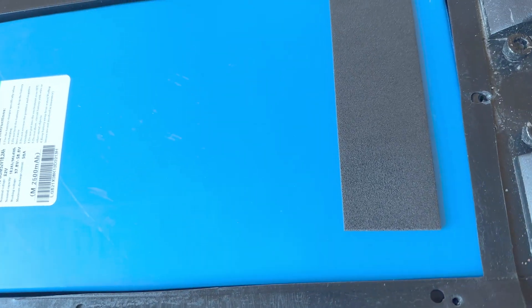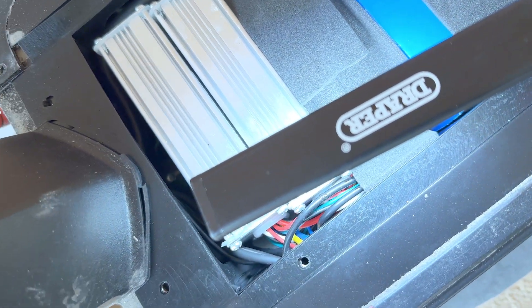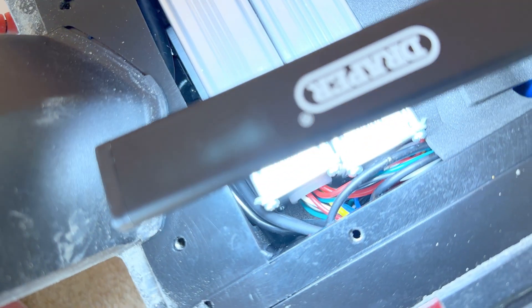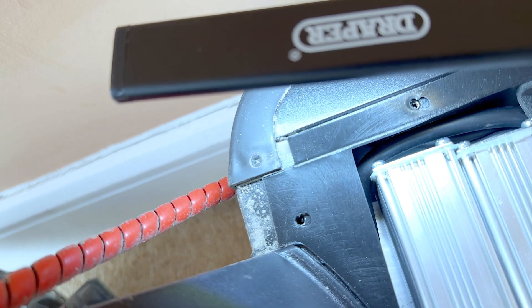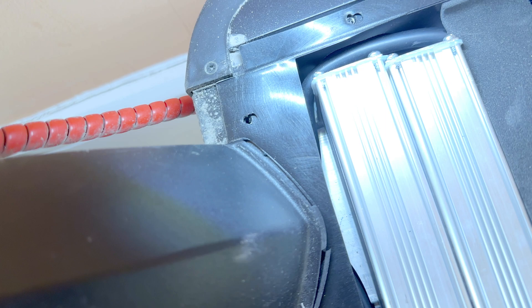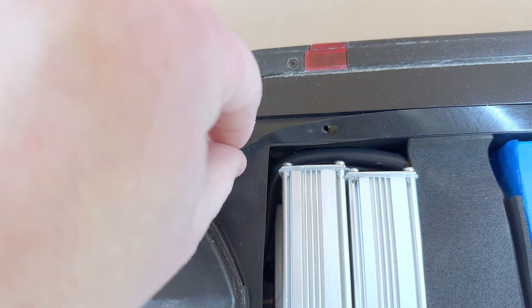Nothing is guaranteed, but when you do go to check, it's always a good idea to check where the gasket is, going around the electric scooter checking for water ingress and water staining. You can see I'm checking where the controllers are and all the cables, because if there is water you will see staining right below on the deck space. Make sure you do use a good LED light so you can really get a good look in there.